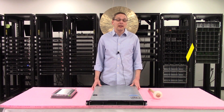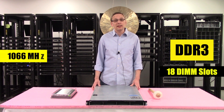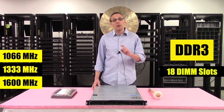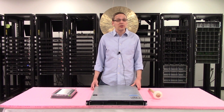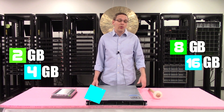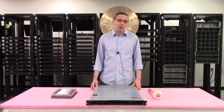On the memory side, it takes DDR3 memory. There are 18 DIMM slots inside. You can use a number of different speeds — as low as 1066, 1333, or all the way up to 1600, though at 1600 it will clock down to 1333, which is the true fastest speed for this machine. As far as DIMM sizes, you can do 2GB, 4GB, 8GB, 16GB, or all the way up to a 32GB memory module. 64GB will not work inside.